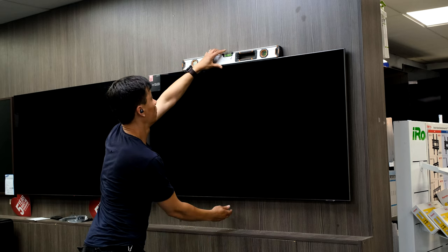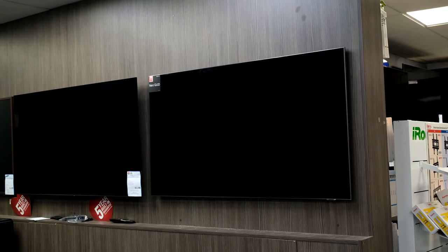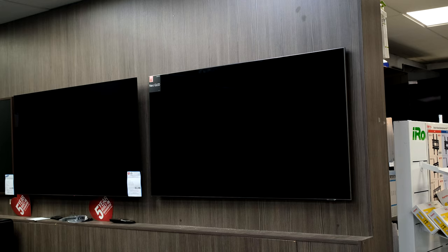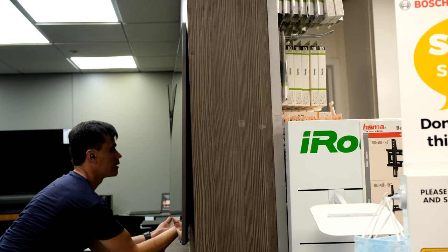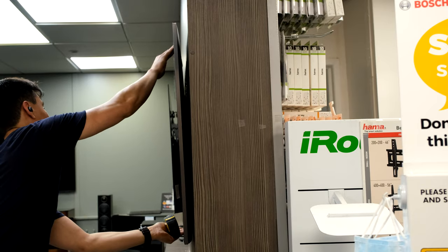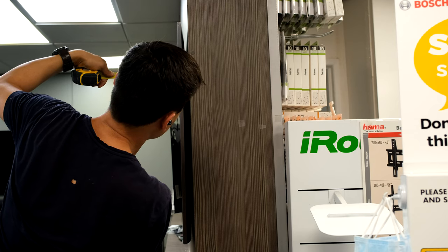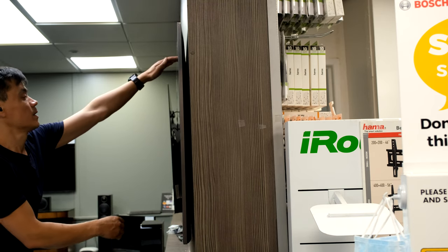You can hear that click. Now I can pull the TV away — those magnets retain it and clip it back. Excellent. Spirit level on the top just to level it up. Seven and a half millimetre gap from the back of the TV to the wall. Pretty nice and close. You can see there's an LG OLED next to it — the 55CX — which comes out about 85mm at the top and 80mm at the bottom. The one connect lead was obstructing it — get that out of the way. So yeah, maybe 33 to 34mm.